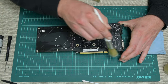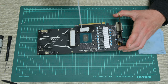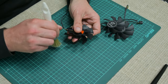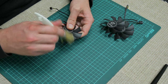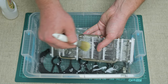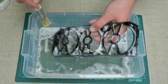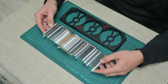As a final step, I re-clean the whole GPU from dust using brushes and isopropyl alcohol. The cooling fans I clean using brushes and isopropyl alcohol as well — I literally wash all three fans. Now the top plastics and the heatsink are a different story. I wash those parts using soap and water to make them fully clean, because later we will do some modifications.